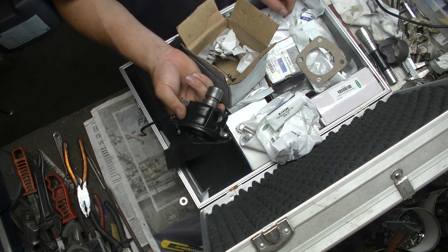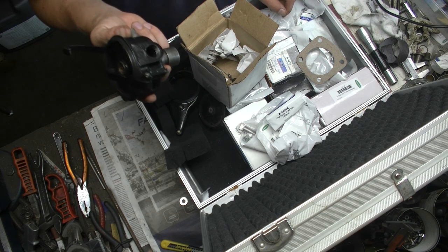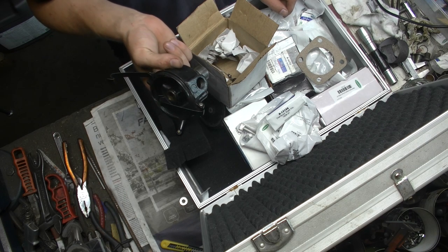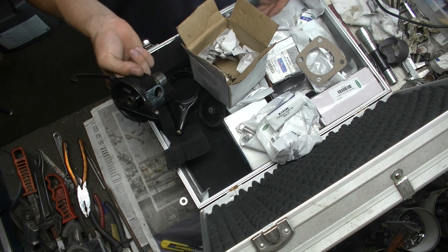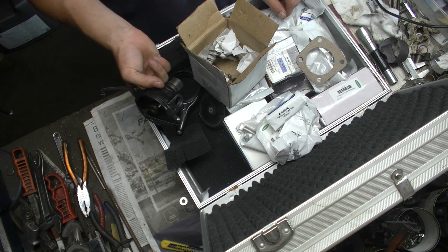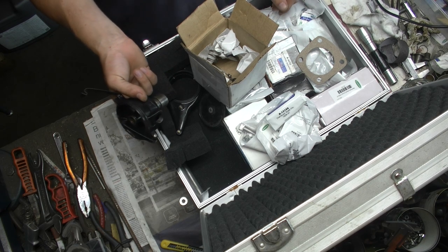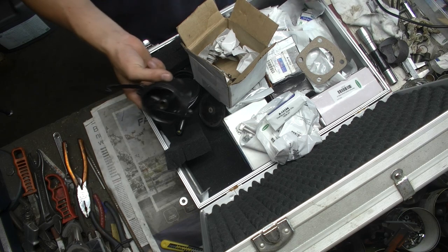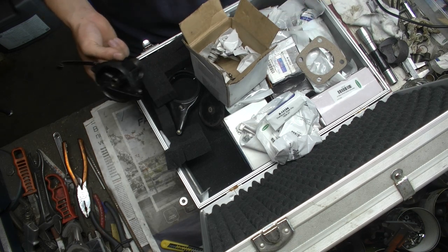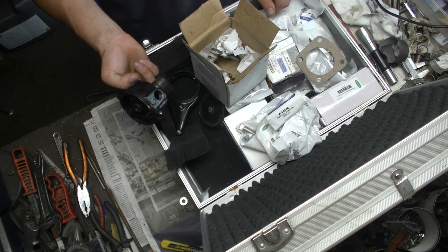My old engine is pretty much dead because there's a crack between cylinder 2 and 3. It's got sleeves in it, and we pressure tested it and it still leaks. So there's no point. Maybe with laser welding or some other techniques it can be fixed, but with the money invested in order to get the engine running properly again, with boring, with honing, new Babbitt or inserts, it's not going to be worth the engine at this point.